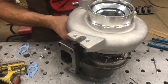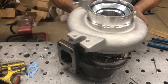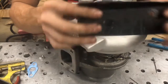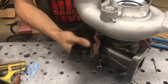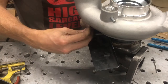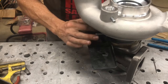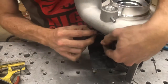Put both of those in. Next thing you're going to do is take one of the gaskets, put that on. You're going to take your spring gate plate — this is the one we use for testing gate pressures, a little beat up, but you're going to take your gate plate and slide it over the studs. Put on your next gasket. Put a little bit of anti-seize on the nuts — not enough to get on the gasket — just want to make sure the nuts don't get seized up through heat cycling. Both materials are stainless steel. Just hand tight for now.